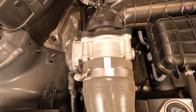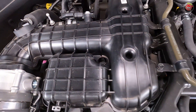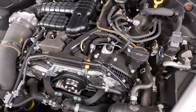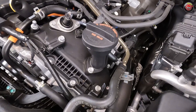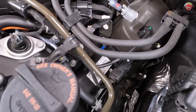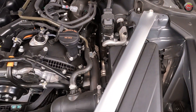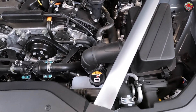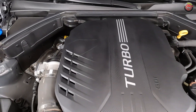With its direct fuel injection, there is little of the fuel system to be seen from above — most of it is hidden underneath. The aluminum four-valve heads feature dual variable cam timing and have the exhaust manifolds cast into them, which allow the turbochargers to bolt directly onto the heads. Looking around the engine compartment, the G70 sports plenty of premium car trim and trappings. Extruded aluminum cross bracing looks finely machined and finished, and complete sound shrouding surrounds the engine itself.